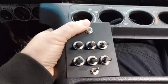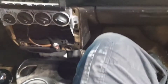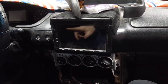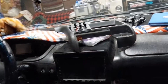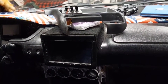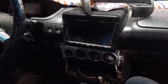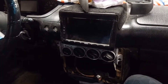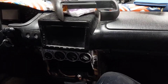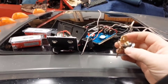I'm going to trim this one a little bit and for now just get it mounted right there, with space to the right for snacks. That will be the main ignition control panel, and there'll be a subsequent panel to the left. There's also going to be a separate key switch that'll kill power to it if I have concerns about security. When I go to use this ignition switch panel, the ignition tumbler is going to be removed entirely — so I won't have steering lock. The likelihood that anybody's going to steal this ugly thing with shark teeth on the side is pretty low.